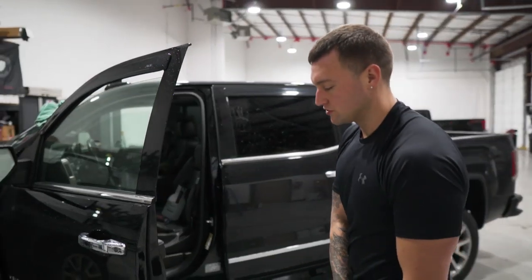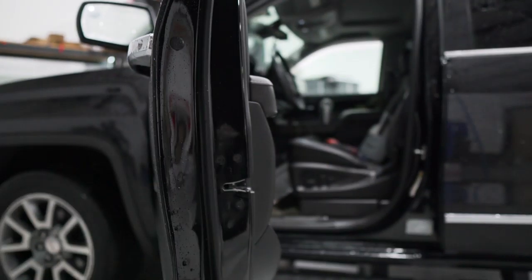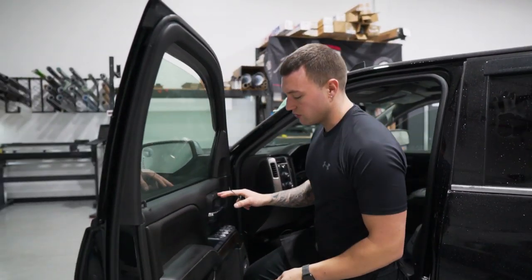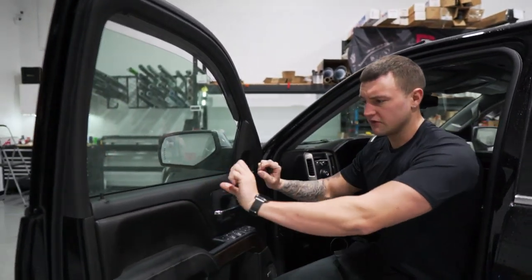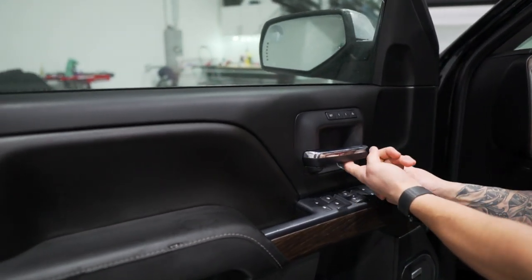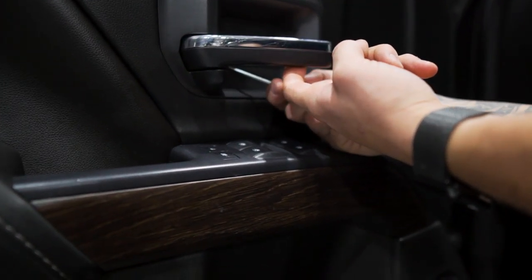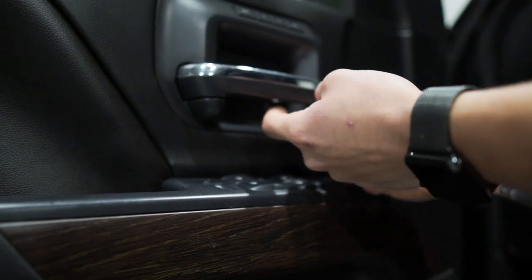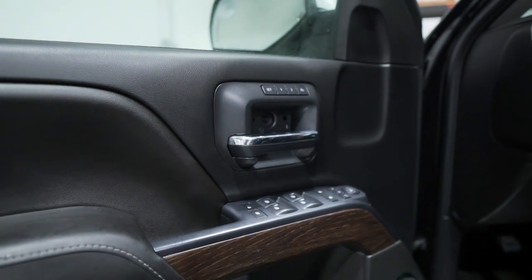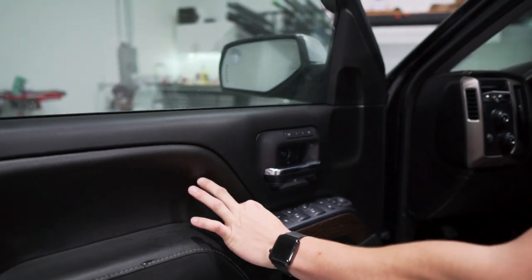First thing you want to do — you hear the door chime, the key's on — you're gonna want to trick the latch to get rid of that noise. To pop the gasket, we don't have to take the whole panel off, we only have to pull back on the top. Remove this plastic cover behind the handle. There's a little notch on the bottom — get the hook tool in there and just pop up on that. It literally just falls out. And we've got a seven millimeter behind there, so we'll back that out and place it in the door cup.